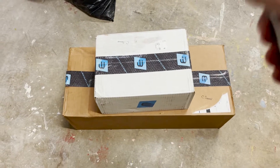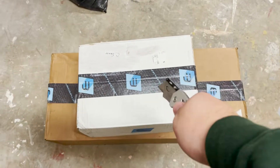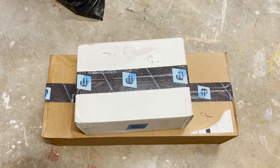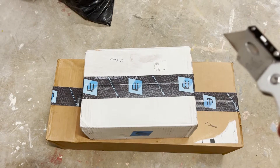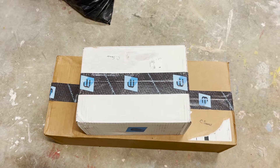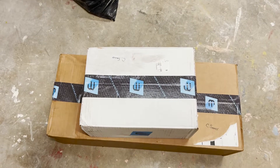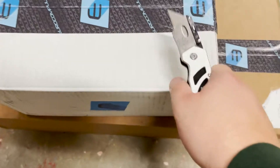So let's go ahead and start tearing into these boxes and see what parts I finally got in for the 124 Spyder Abarth. In this top box should be our Stage 1: the Euro Compulsion tuner, the coil packs, spark plugs, and the diverter valve. The representative at Euro Compulsion said that should be good for almost 40 wheel horsepower on a car that already only had about 165.